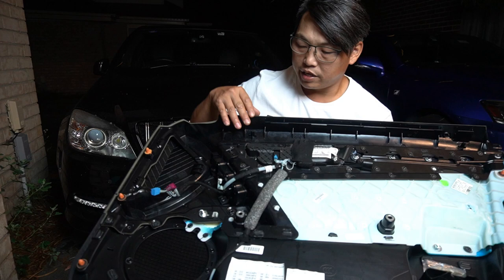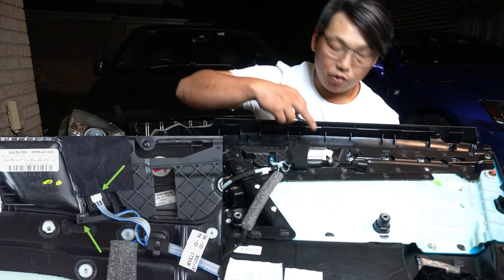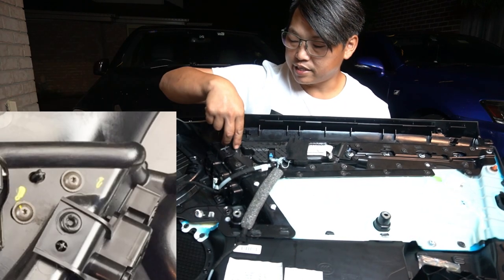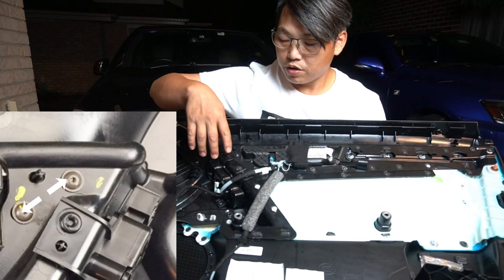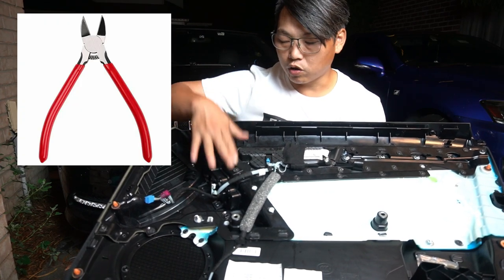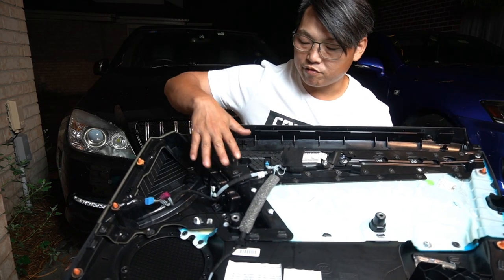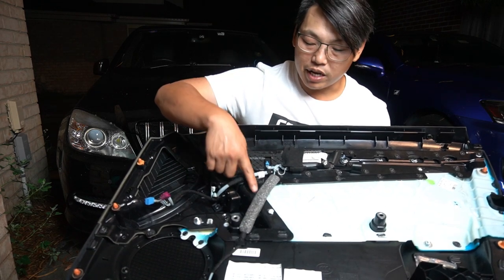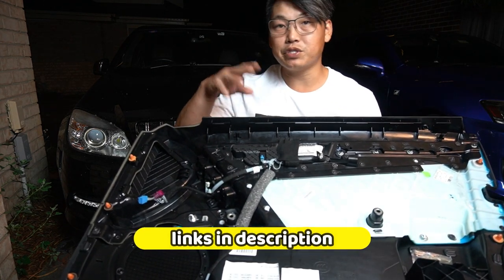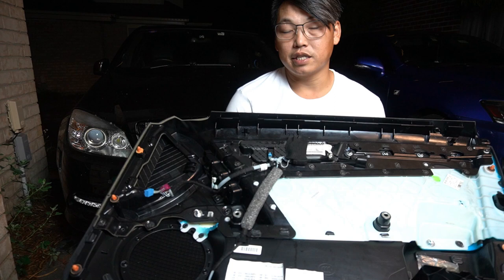Here's a brief rundown: you need to unplug your electrical connectors and also unplug the ambient light for the door handle. Remove five aluminium 10mm nuts and also two T10 Torx screws. You're going to need a set of wire cutters or pliers to cut close to plastic — in my case I used a trim clip removal tool, which allowed me to cut flush with the plastic and cut the melted tabs off really easily. I'll leave links in the description for everything I used.